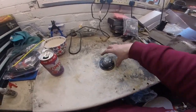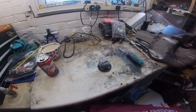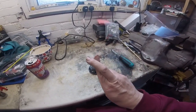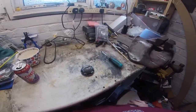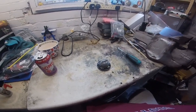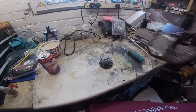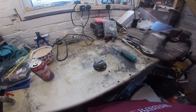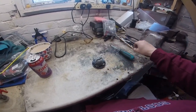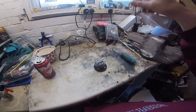Ooh, yes. I've just refilled, or in the process of refilling, the coolant system on the ZZR, and so far no leaks other than what I've spilt on the floor. Standard practice. I turned the fuel to reserve. There should be enough fuel in it. Well, that's debatable because I actually took some out to put in Phyllis, so there probably isn't enough fuel in it to get past the petcocks. There's two, one higher in the tank for normal and one lower in the tank. There's actually two separate feeds, which is unusual.